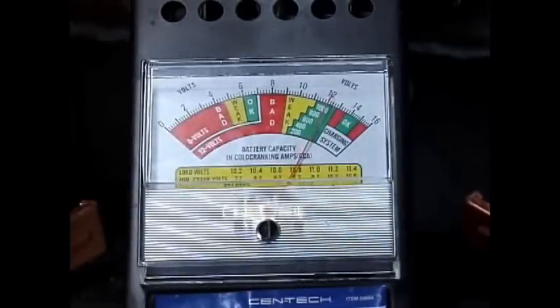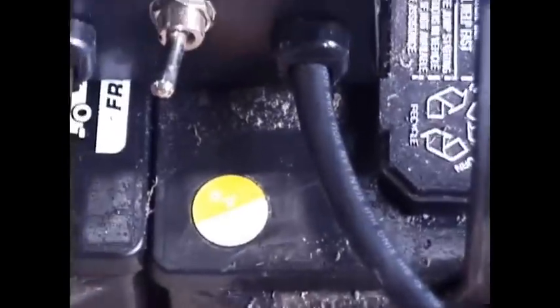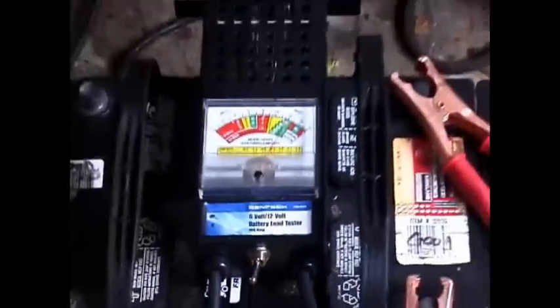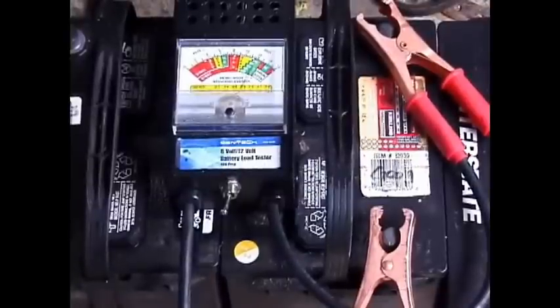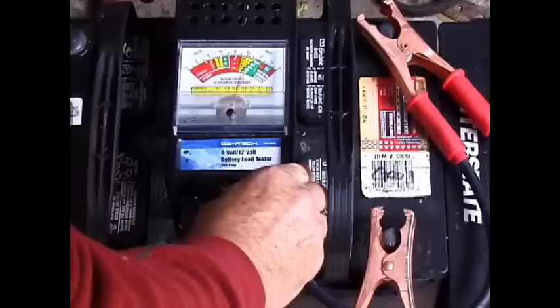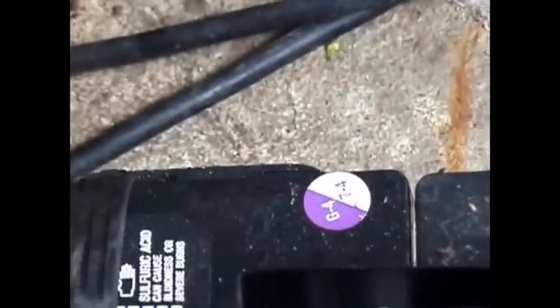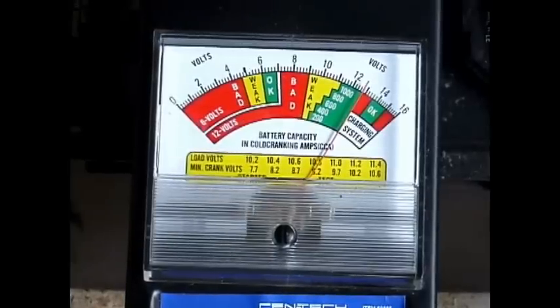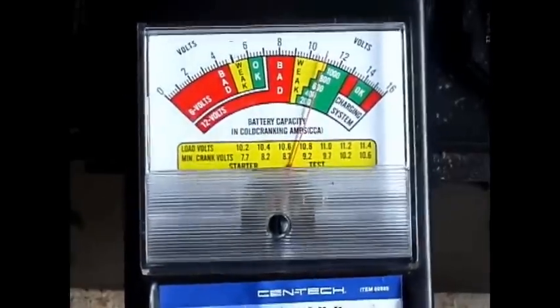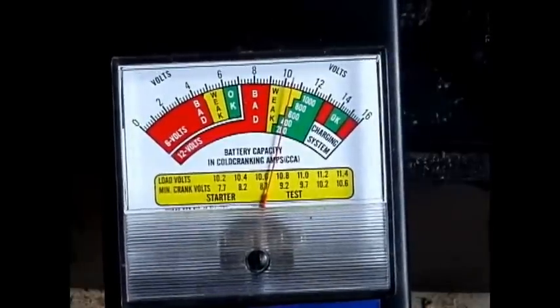This battery is not coming back enough to be serviceable. It has come back remarkably considering it had nothing to start with and sat for years, but it did not recover sufficient capacity. This battery is from August 2004. We're going to load test it — it's sitting in the pile for a bunch of years, running at about 12.3 to 12.4 volts, and when I put the tester on it, it's over 600 cold cranking amps. This battery from 2004 is at about 12.8 volts and running about 800 cold cranking amps, sticking above 600.